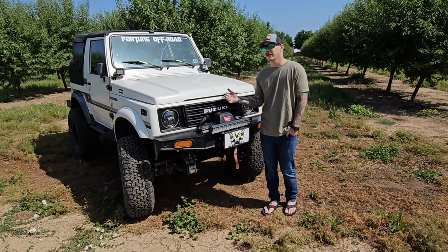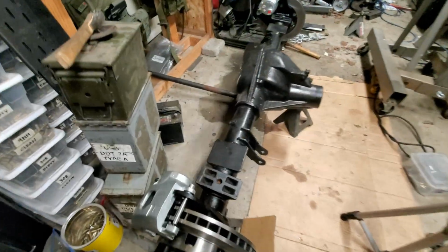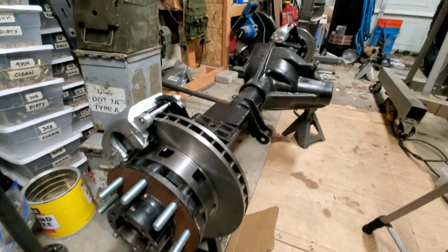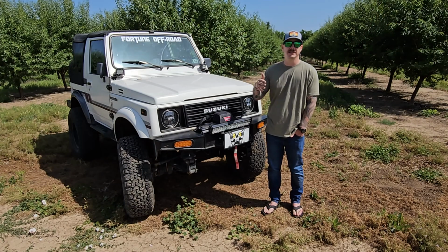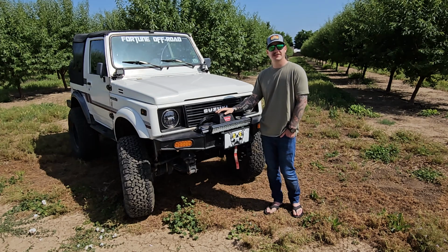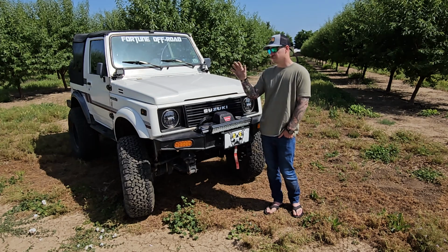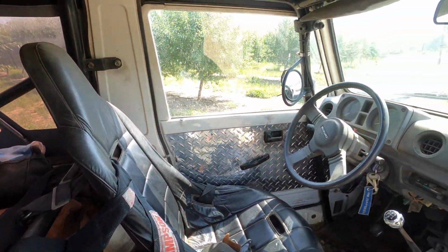What we kind of narrowed it down to is we need to go 1 ton in 40s. Yeah, it sounds kind of ridiculous, but the Dana 70, Dana 60 combo can go 7.17 in the axles. And with just that gearing upgrade alone, we'll go from 87 to like 167-to-1. Axles that big, why not go big tires? So we're about to stretch this thing, 1 ton at 40s. We're really looking forward to it. I wanted to get this video out before we tear it apart.